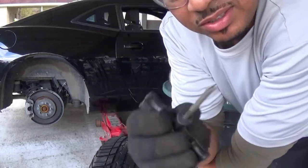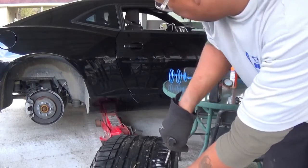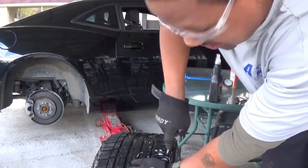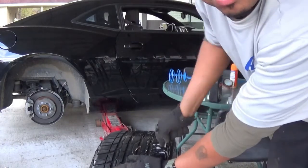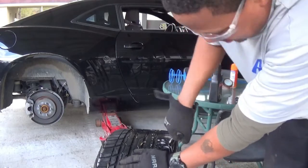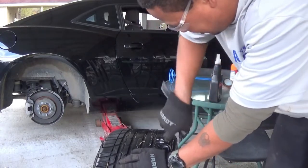I'm going to take your little tool again. Now this is going to save you a couple dollars at the tire shop. You don't want to be spending all your money going to the tire shop when you can do it yourself. See, you get a little kit. You take this T-handle, you stick it in there. See there? And you're going to ream that hole — ream it, all that at the same time.